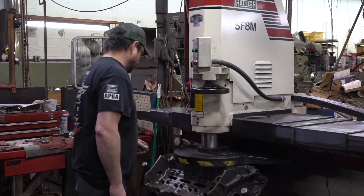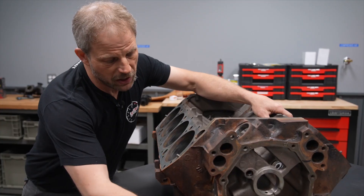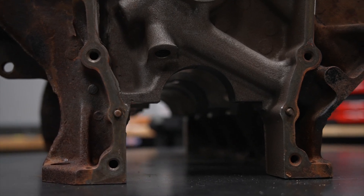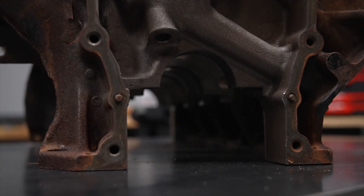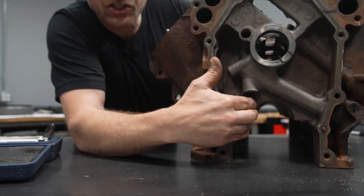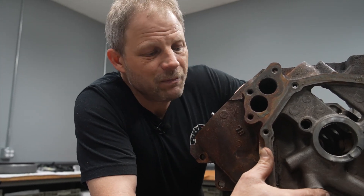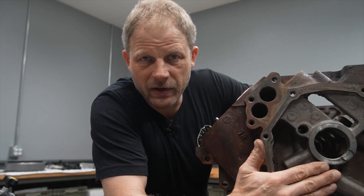Last, if you're going to a real high-performance build, you may end up having to align hone your crank journals. The align bore is what your crank journals look like — they're aligned so they're perfectly in a straight line and square. For a stock block in a stock application, you most likely won't have to have that done. But if you found a block that was missing one main cap and found a replacement, it's not the cap it was originally machined with, so you're going to have to have that align honed.